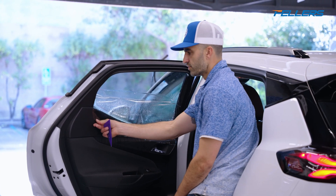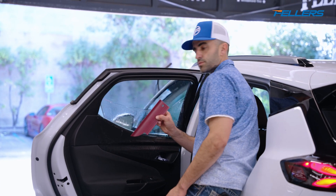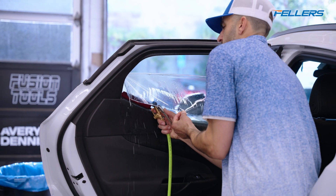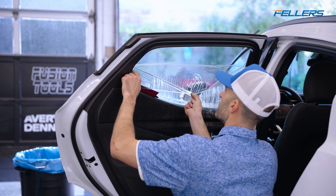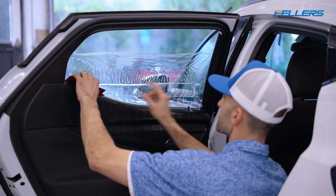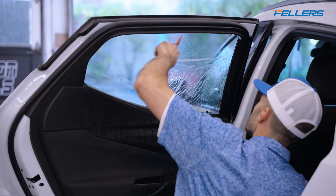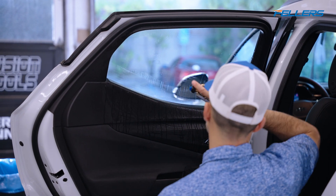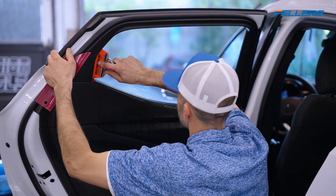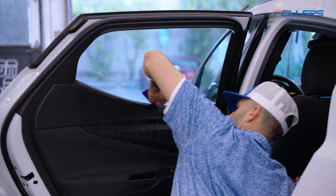Now I can roll the window up. I carefully remove the liner off this corner, then come across. Now I'm going to show you how to use my favorite tucking tool. We start by getting it underneath the gasket, then use your TrueSpray system to soak underneath the film. Get the film on the other side of the Red Devil, put your finger to the glass, pull it tight, slide it across — boom. Now I'll go over it again; that's the preliminary. Then go over it nice and hard using my Fusion squeegee from fellers.com, staying away from the edges. Take your hard card, hit the edges, hit the bottom, and boom.